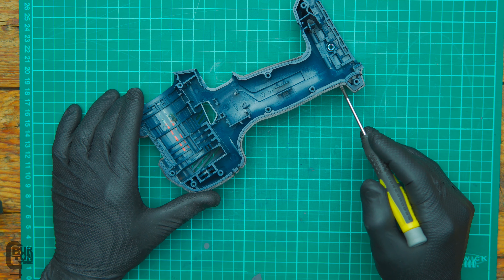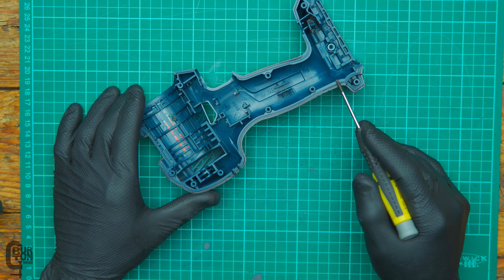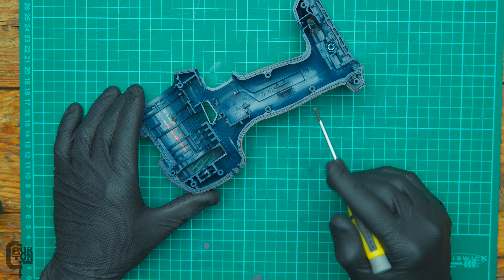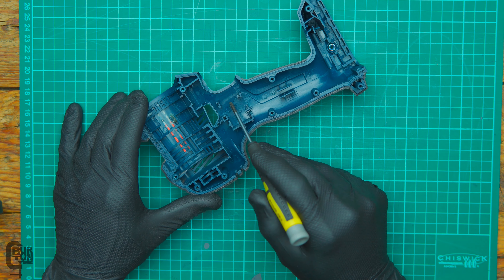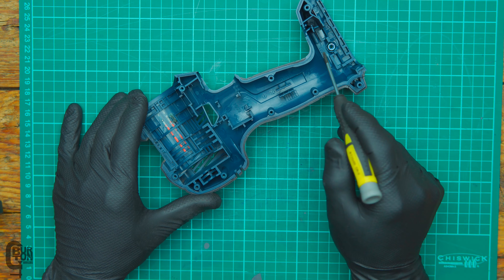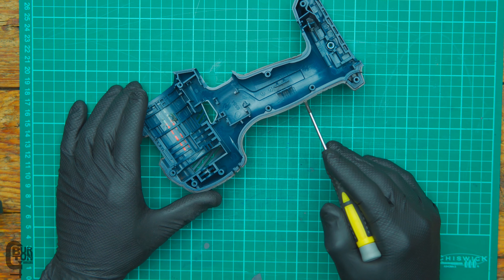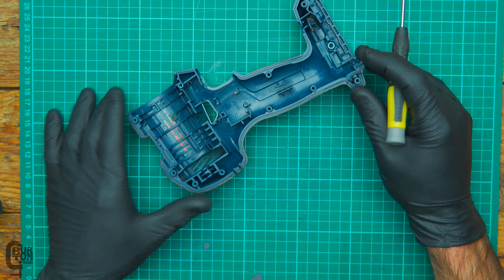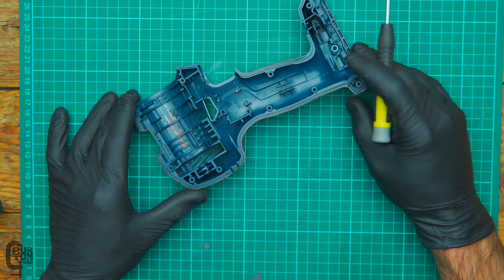With a lot of other tools I've seen, there are small dovetail joints, so the TPE will actually be dovetailed into the nylon clamshell. You might find one of those dovetails dotted around the outside, and that helps the TPE stay adhered to the clamshell. Sometimes you'll also see little nibs — little holes placed throughout the casing — and the TPE will actually protrude through, helping this rubber section stay stuck to the clamshell. Not too sure what they're doing here. I really hope this doesn't come off over time — that'll be quite sad — but so far it looks pretty good.